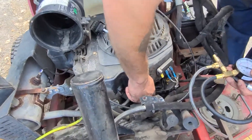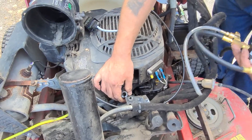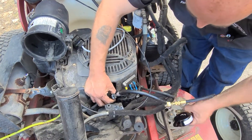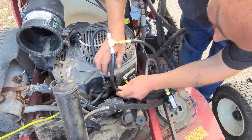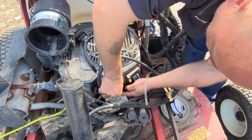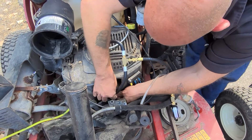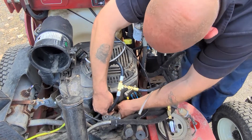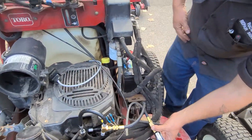What we're going to do is disconnect — there was a clip in here — disconnect from the fuel pump, put our pressure sensor in here, and plug this into the fuel pump. 34 pounds of pressure is ideal; that's where we want to be. If we're in the 20s, we know the problem is the fuel pump.